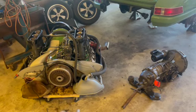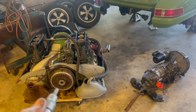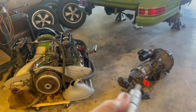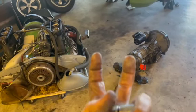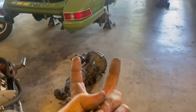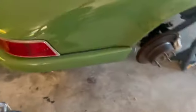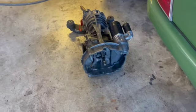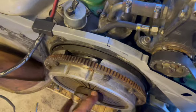We're going to put the clutch alignment tool away. Going to take these to 14 to 18 pounds on the pressure plate. Then we'll mate the transmission. Remember, 70-71, real fun, you know. These are pull clutches on 70-71. So what you have to do is get that alignment fork, which would normally be your clutch fork. There. And guys, it's got to slide behind the throw-out bearing. It's got to lock in behind.